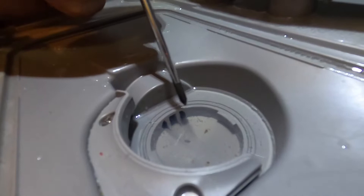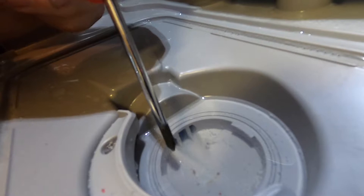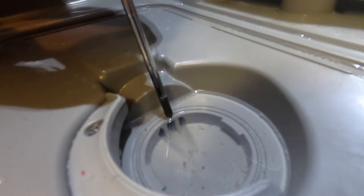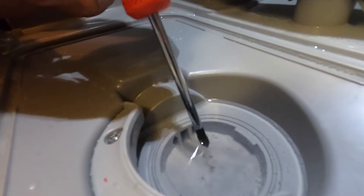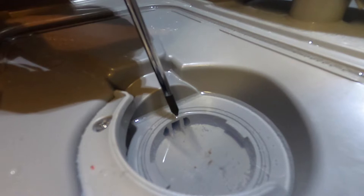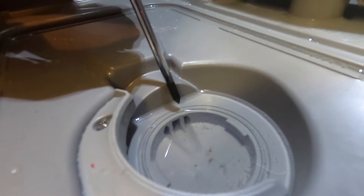You can see a little better here — I'm using my Phillips screwdriver to show you these three little drain inlets where water cycles through the whole system as it runs its wash. This is where I actually had the corn kernel stuck. I believe it was in the center one, and it just flowed backwards with the water sitting idle, so I was able to scoop it out and clean out everything in this area. One of these inlets had gotten plugged up, and instead of damaging other parts of the system it simply gives the error code to let you know something is wrong down in here.